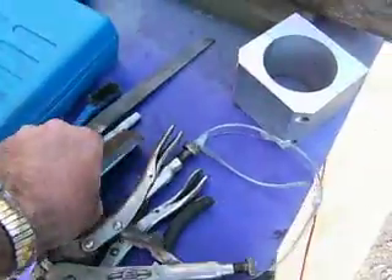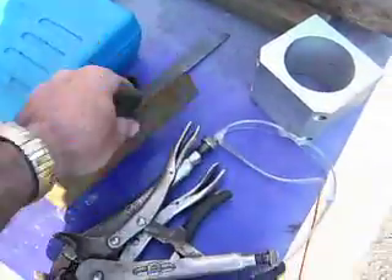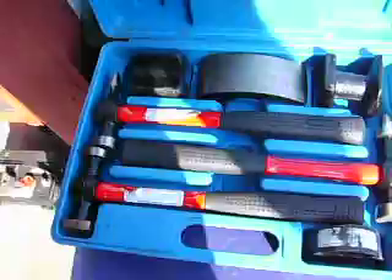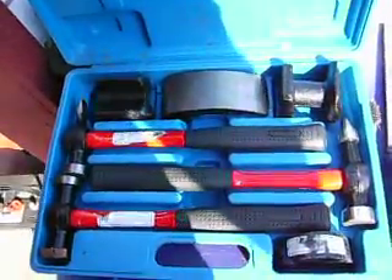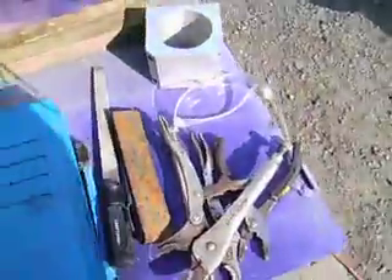Check out the tools here — we're talking hand filing, here's the angle iron that I used to crimp the new edge over, and vice grips. I got a whole dolly kit, this is all I needed. I got my welder, gasless MIG, my DA sander, and my angle grinder. This is the equipment that I used to refabricate this fender.